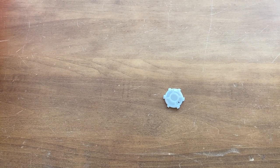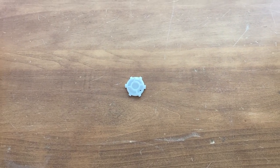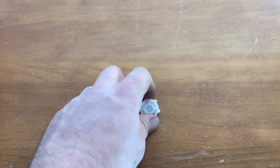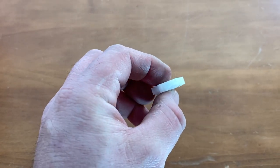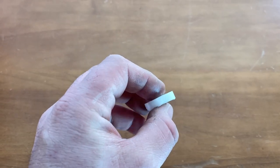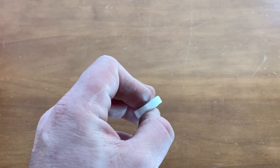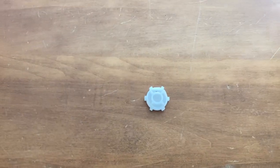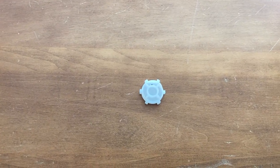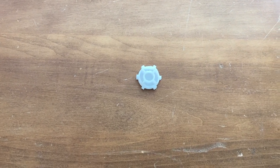This piece should not be made out of simple plastic — it really should be made out of something more durable, whether that's aluminum or steel. This is the main problem: it broke off. It's kind of hard to see, but you can see the uneven edges on that white barrel that changes the tension on the spring. We found the root cause — it wasn't something that slid out of track, it is an actual broken part.